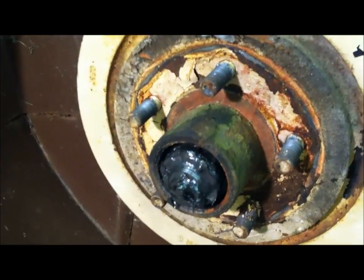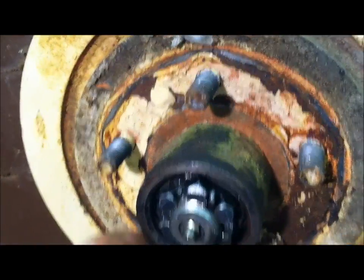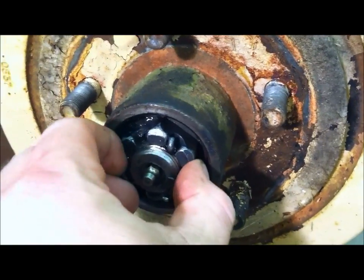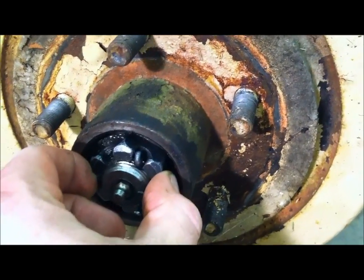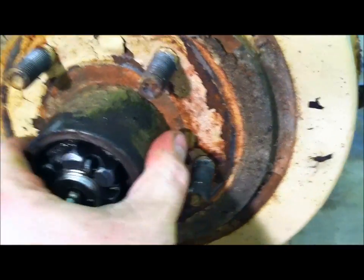Let me get this cleaned up and I'll show you how it comes apart. It's all cleaned up — typically I wouldn't even clean that off, I just spin everything off and clean it up later, but I'm trying to show you guys. Here's your nut, and then a cotter pin holding the nut on. Now if you see, that nut's loose — it's not supposed to be loose. I know it was tight because I do this every year. What that's telling me is that my bearings are worn. At least one if not both bearings are bad in this hub.